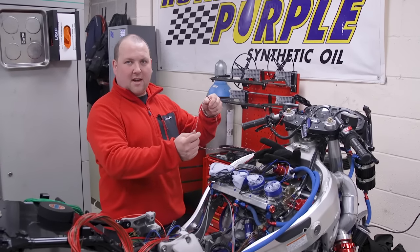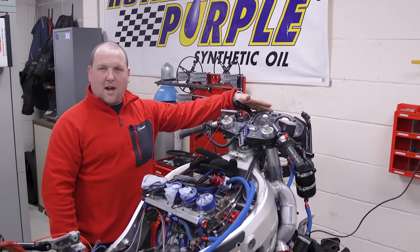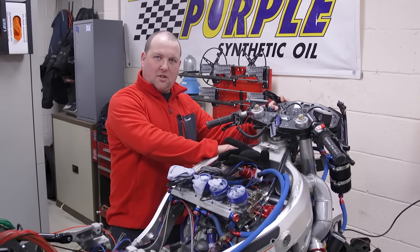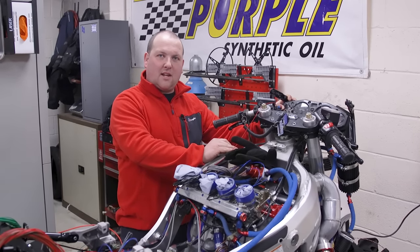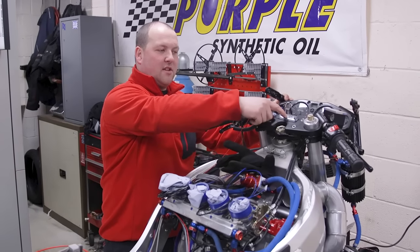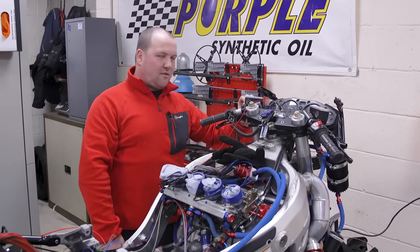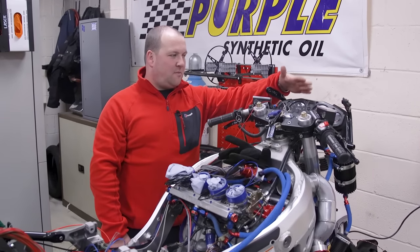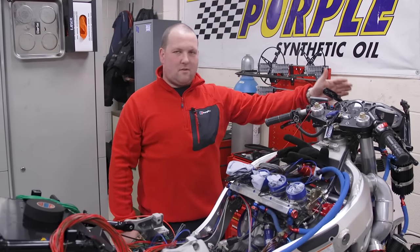Last but not least is this wire here — that's a pair of CAN lines, so that's speedo. I really wanted to keep that speedo, but unfortunately it won't give us everything we need to know, so I think we're going to be changing that out for an iPad mini. We've run a CAN bus line up and we'll run live and earth up to keep the iPad charged. The CAN wire will be there just in case we need to change that dash out to a different one, because the problem with iPads is they're not amazing in direct sunlight — we might not be able to see the rev counter. We're going to keep that LED light — it's actually a hazard warning light off the back of a truck — but it's a really bright LED, so that's our shift light. Once we see that, we push it and change gear. I do normally like analog gauges, but I'm going to change it for an iPad just to get the bike up and running as quick as possible. Once we're happy with it, we can change it out because we've already put the wiring in.